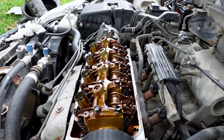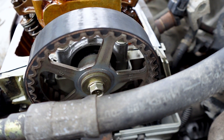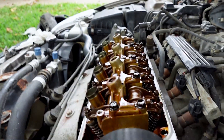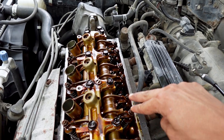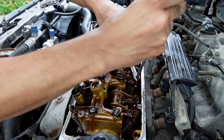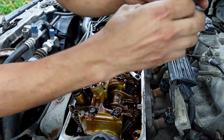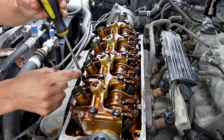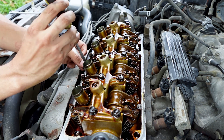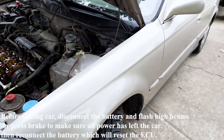Number three is finished up. I turned the crank counterclockwise — the 'up' spoke is now facing the rear of the car and the line on the cam gear is facing all the way up. The last cylinder we have to do is number two — intake and exhaust. And as far as valve lash goes, we are all finished up.